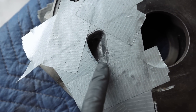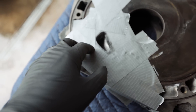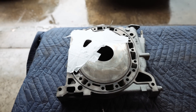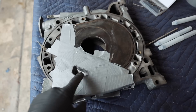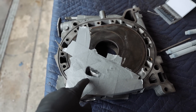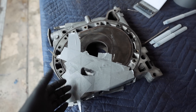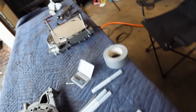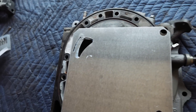Here on our center iron I've gotten the shape of the port done on both sides. We do need to port the inside of the opening, and then we need to polish it, but the size of the port opening on the internal side is pretty much ported out now. We're doing what's called a half bridge. The reason you do this on a rotary is because there's no cylinder head, no camshafts — the only way to get more air in and out of the engine physically is by enlarging these ports. With a full bridge it makes it very difficult to tune idle and heavily increases fuel consumption, so we're doing a half bridge, which means you don't do a bridge on the center iron — all we did was enlarge the port for air.